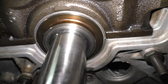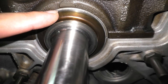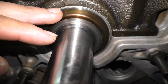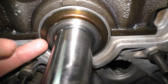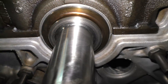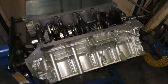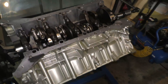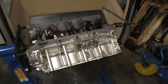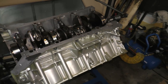It's really important to maintain proper bearing clearances because there's supposed to be a thin film of oil between the crankshaft and the bearing. Without it, the crankshaft will scratch against the bearing and wear it out quickly. If clearances are too small, oil can't flow between the bearing and crankshaft. If they're too big, oil pressure won't build up properly — oil might flow out one side and the other side gets no oil at all. So that's everything for this video. I'm really happy with how the engine is going. Hopefully the next parts — timing cover, heads, and everything else — go just as well. Stay tuned!